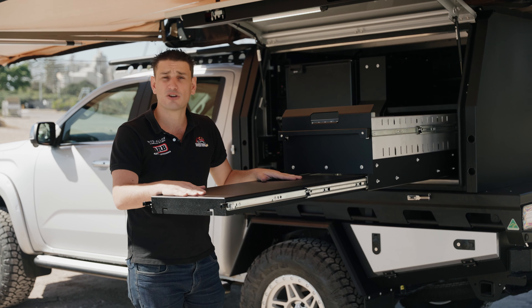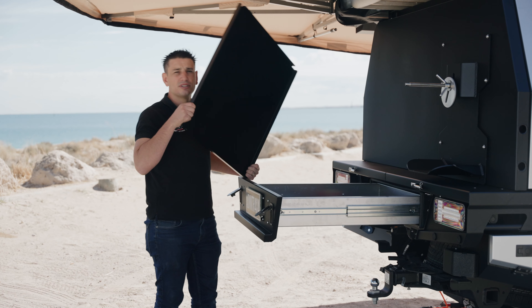With any new modern vehicle comes a whole raft of technology which is great for safety functions. We don't want to get rid of any of those safety functions. When we take your original tub off, we take out your blind spot monitors, reverse sensors, and reverse camera from the vehicle and they all get relocated into the back of the tray itself. We 3D print the mounts for the sensors, surrounds, and camera. The camera sits perfectly centre of the vehicle so when you're hitching up you can see exactly when you're going to get your tow ball just right.